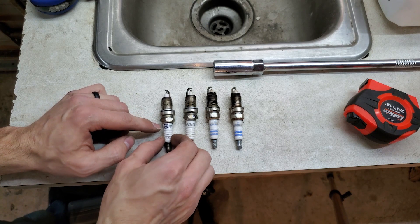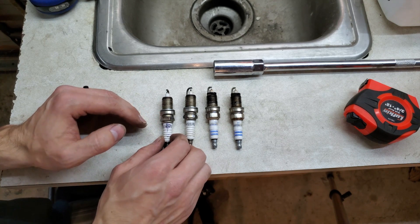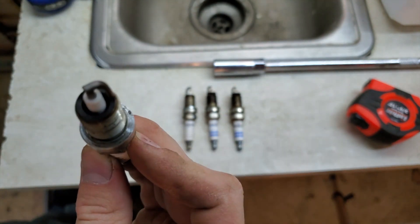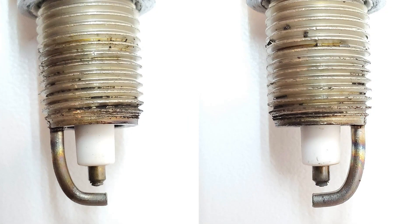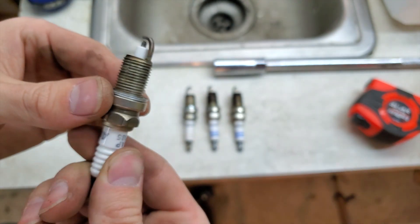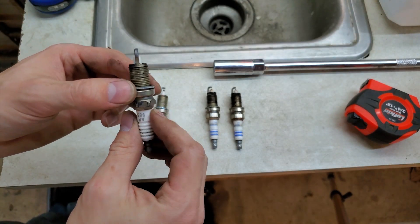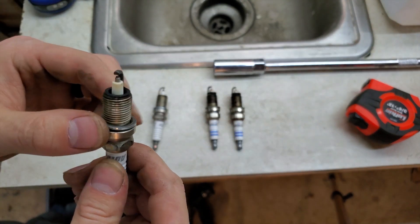I don't think that's going to throw things off too much. This one here — you can see I have a '10' written on it — because this plug has only been in the Jeep since the fuel has been enriched to 10%, and it hasn't been very long. This plug is just sparkly clean. There really isn't a lot going on here. I'll show some more detailed photos so all of you spark plug readers can tell me what's really going on, because it's not necessarily my strong suit. It's a very clean plug with the exception of just a little bit of black on the top. Now cylinder two has been in for a few months and looks very clean with a little bit of yellowing — it looks very nice. These are copper plugs, by the way.